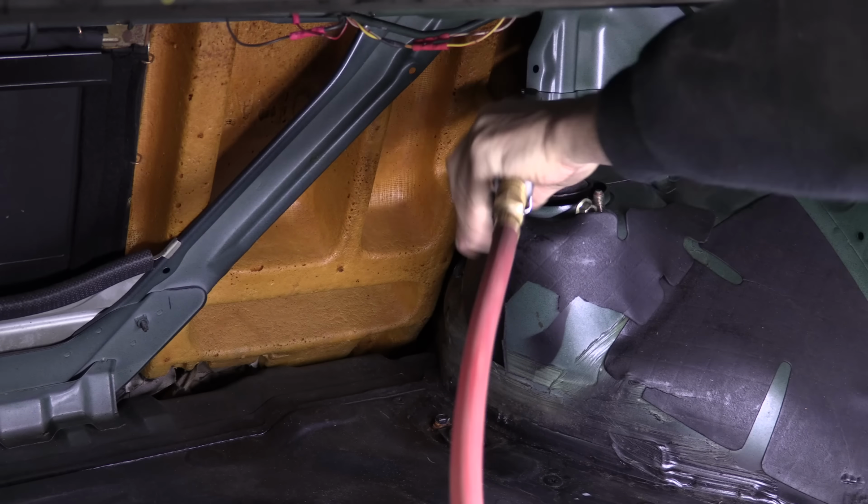Fortunately, the flange that the valve is bolted to is raised and flat, so I'm able to make the rusty part itself its own bolt head. Rotate the whole part, and the bolt comes loose. Nice. Relieved by that victory, I decided to grab the impact and release every accessible bolt I could get to, which really weren't many.